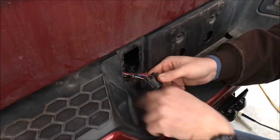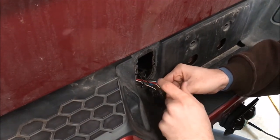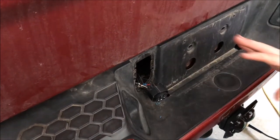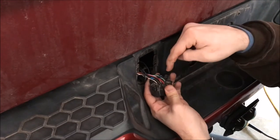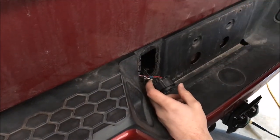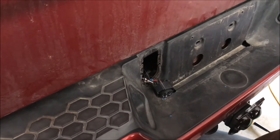White with green is your right directional. Orange with white is your left directional. The brown wire is going to be your ground, and the gray wire on the back is going to be your power wire. If yours aren't the same, check out my other video which goes into more detail on how to find out which is which using a volt meter. You expose the wires, probe them, turn the right directional on, and find out which is getting power as it blinks. Then just cut off the flat pin and start your soldering.